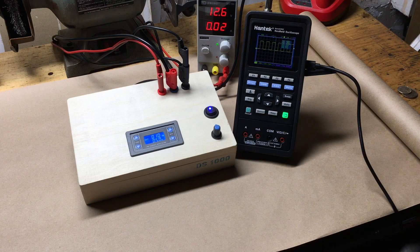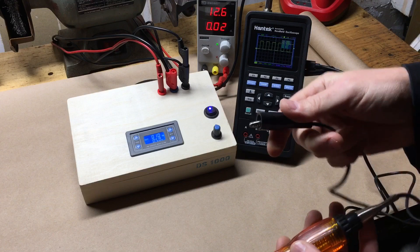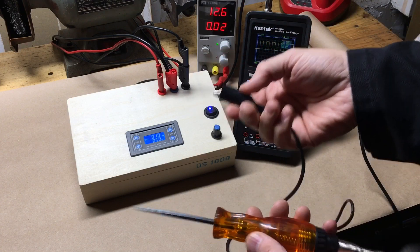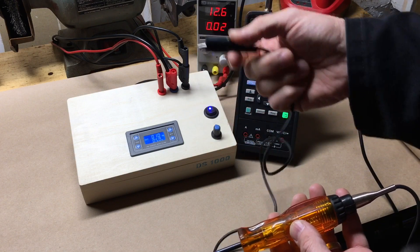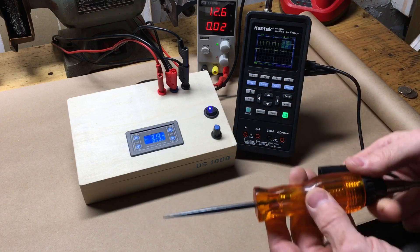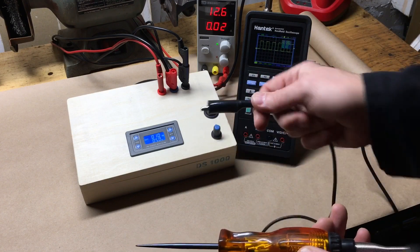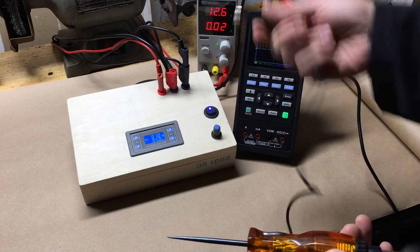Some of you may or may not be aware, I was doing a bit of troubleshooting on one of my vehicles — my boy's car. I had some issues with wiring lately and I was using my little test light. This one is a single clip type, dual LED — red LED if you clip to battery negative and pick up power, and green if you clip to battery positive and pick up a ground. I forgot how useful that actually is, and then I forgot what a pain it is to keep constantly switching between power and ground with respect to the clip.